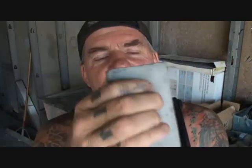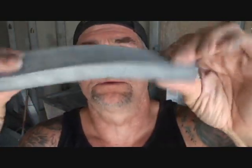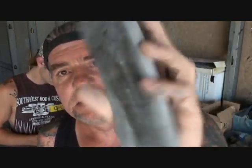This was part of the foam, and you can see that this is a very flexible block and it works very, very well. This is one of my main blocks when I'm working on an old classic antique car with big round fenders — such as a Karmann Ghia, a Volkswagen Bug, or a '57 Chevy. Hand blocking is very important when sanding to get your body work proper without using your bare hand. If you look here you can see the ridges in my fingers — using your hand is a bad idea. So I made this block so I can use my hand and it will form to my hand as I am sanding.